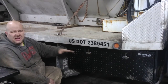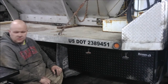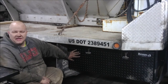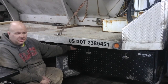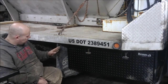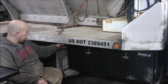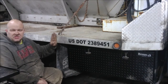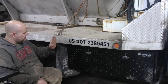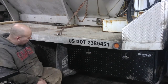The only issue I had to deal with was this box lands where my mud flap is supposed to land. So I took it off and sat it on the front piece — this has got C-channel underneath, like a 3-inch tall C-channel, and the flat side is here, so it's just bolted to the front of that. What I did is took the same C-channel I used to make the boxes and just spaced it back 3 inches. We're good — we got some mud flap again.